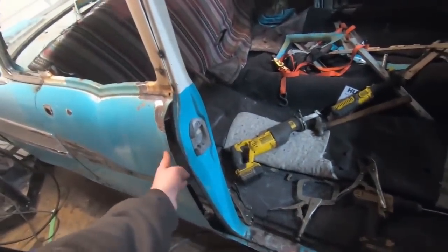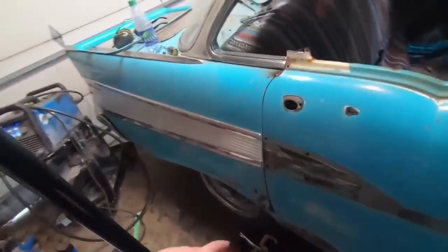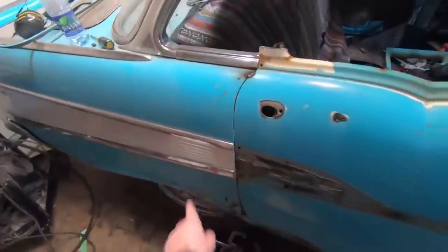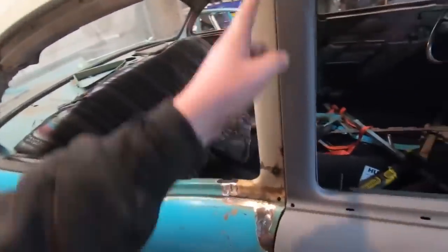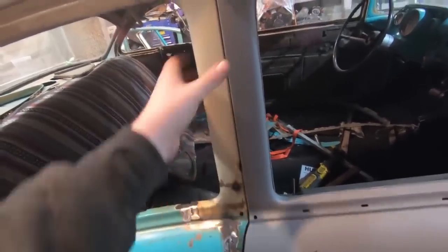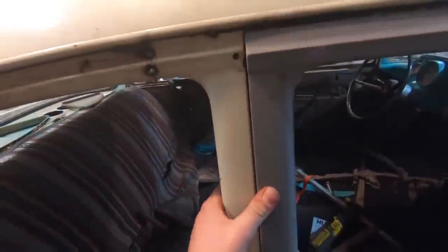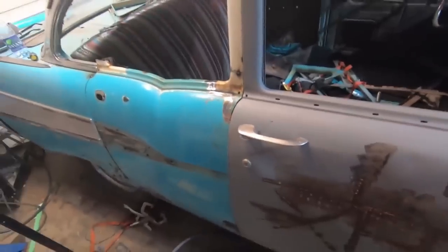So there we go — holding the panel for coming in and out. There'll be a bunch of times opening and closing the door, and then I've got to sand down all around there, weld the doors in on both sides, a little bit of trimming here and there. But overall it's pretty good. This is the pain in the ass part — on the four-door door, the post goes down and actually kind of kicks over and then down. That's why on the four-door it's got that little piece that runs down. So to make it look like a proper two-door, it's a little bit of screwing around in there. But I'm happy with it.